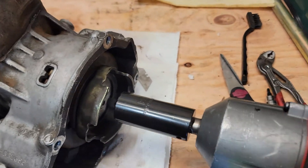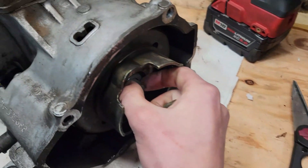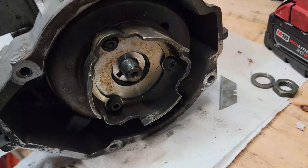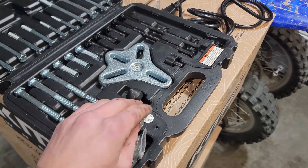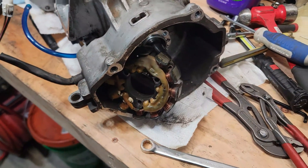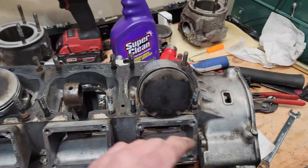First, we've got a 24-millimeter socket to take this off. That comes off easily. Then we take off the three screws that hold the starter cup. The rest of the flywheel gets removed with a flywheel puller kit — only about $20 from Harbor Freight, or you can rent one for free from AutoZone. I got the flywheel off and removed the screws holding the magneto in place. Looking up top, all the cylinders are removed.